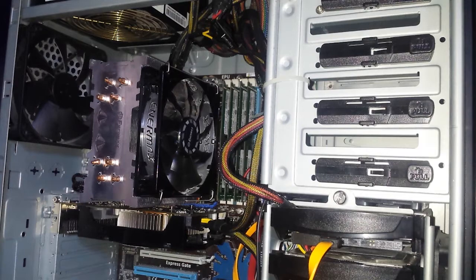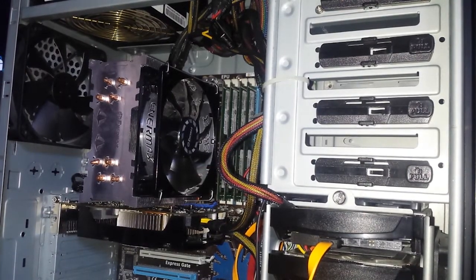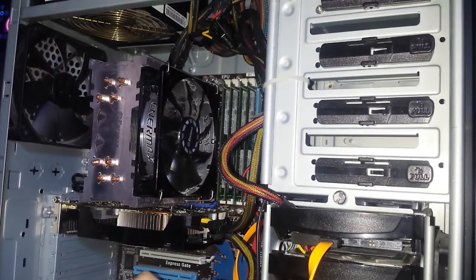While we're in here, I also have an Intel i7-860 running at 3.6 GHz. I have 3 1-terabyte hard drives, obviously for video storage. I have 8 gigs of ECC memory. It's an Asus P7P55D-LE motherboard. It's a pretty good motherboard. It has a MemOK button, so if I ever need to install new RAM, it can tell me whether it's compatible or not. I have 3 PCI Express slots, and then another PCIe port there if I ever want to do SLI, because this one is capable of SLI. So I might buy another 950, and then hopefully run them in SLI. Well, that's pretty much it.